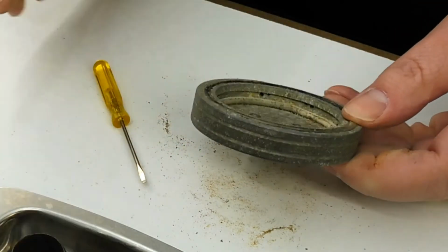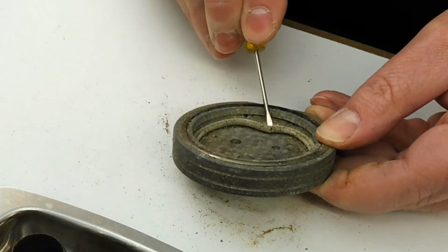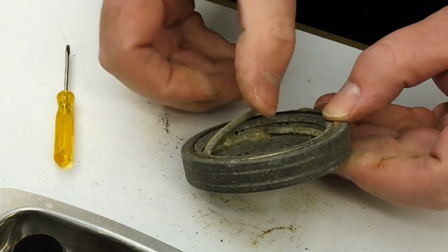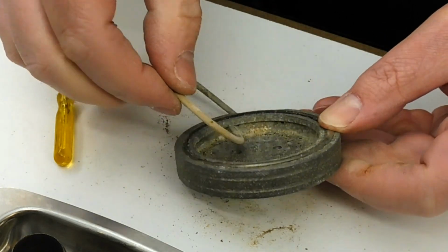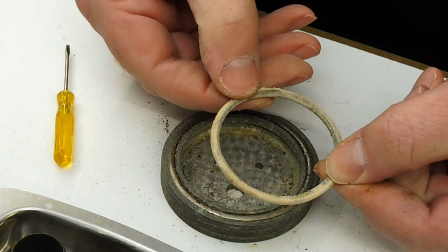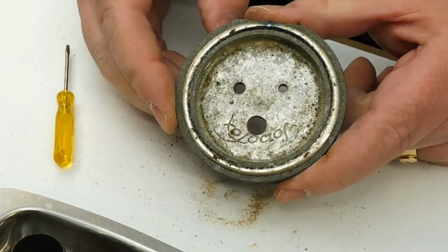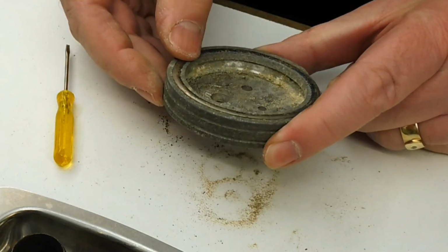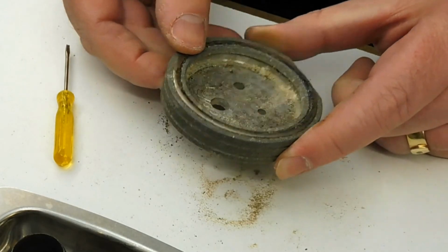And then there's the other gasket, which we'll just lift out, and it's useful that they'll come out in one go, because that means there is actually a fair chance that I can measure them and make new gaskets which will be the same size. So that's quite handy. So even though I was worried there might be some clever screw mechanism in the front, something around this ferrous ring, it could just be decorative.